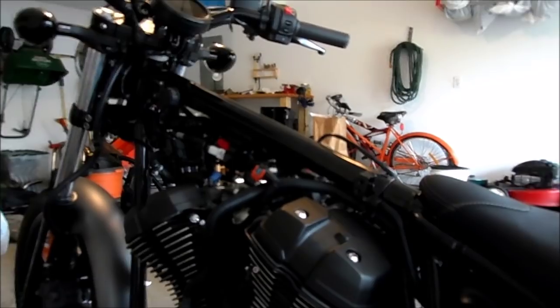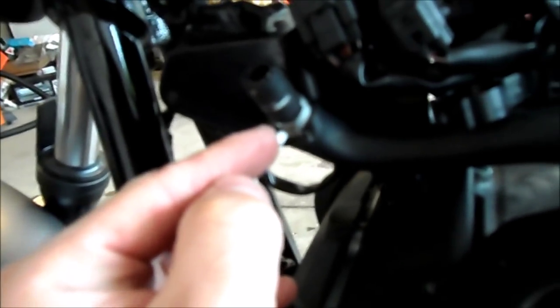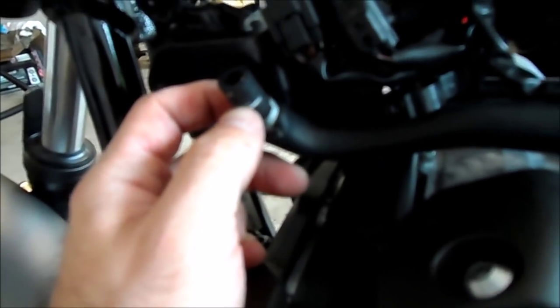You want to ride around a little to get it a little lighter. So this was that orange clip I was talking about — see how it goes up. What you're going to have to do is pull down. There's a blue part on both sides — you've got to pinch both blue parts then pull back and that'll come out. For the blue clip here, you're going to push in on this part right here and that's going to pull out the back of that fuel pump. This one — the hardest part is getting the metal clip down. You've got to get it pretty far down. This double insulation here makes it difficult, so take your time, get that clip way down, and then that'll come out.